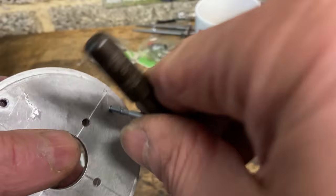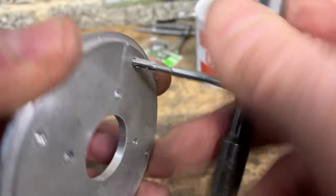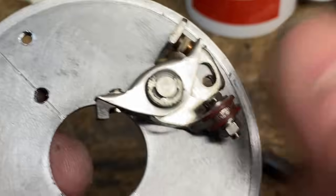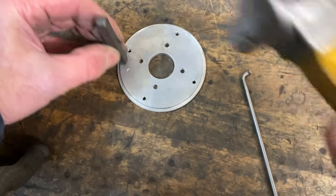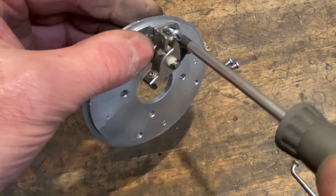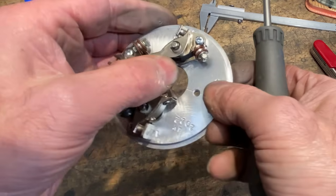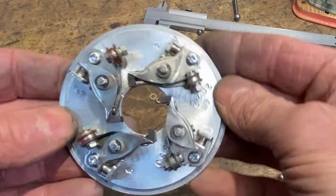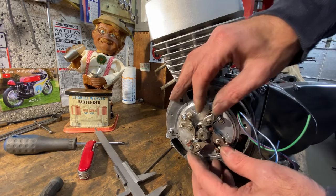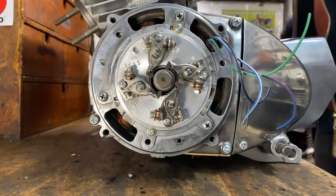With all the holes drilled, I tap out the four outer holes with an M4 tap. With the four holes tapped, I try on one set of points and it fits just nice — tight on the pivot and rotates backwards and forwards. I stamp that number one and then stamp the remaining cylinders. With the new stator plate finished, I put on all four sets of points and do up the screws. It snaps on nicely, engaging in the recess and rotating backwards and forwards really smoothly, so I do up the two screws to hold it in place. I kick over the engine a couple of times and the points open and close perfectly.